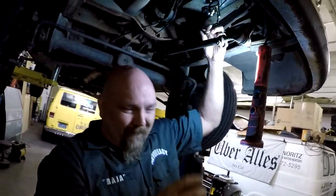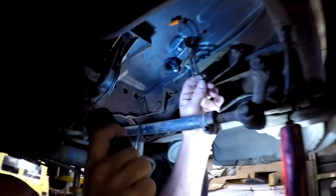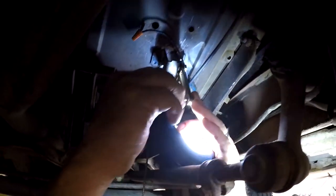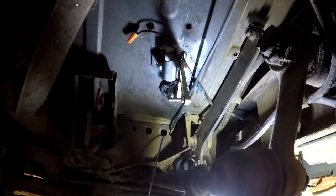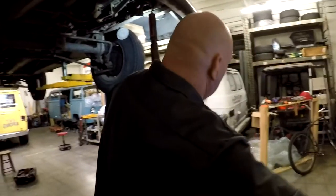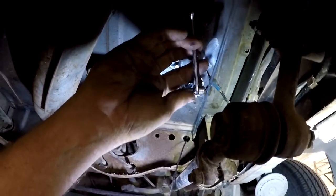We get our hardware and supply from Top Line. The hole in this aftermarket piece is threaded for 6 millimeter; the 5 millimeter fits fairly tight, so we just run a nut up on that guy and torque this one in place so it doesn't spin. That way you don't ever wear out your aftermarket expensive L-bracket barrel cable linkage.